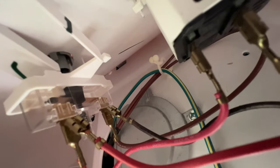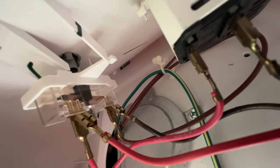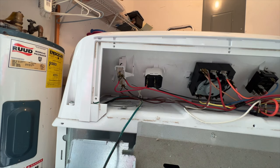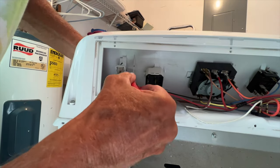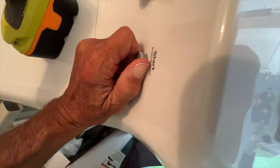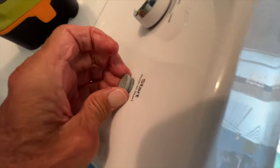To remove the start button, we've got to reach in there and squeeze those three little catches that go around the collar to get it out. I've got to pop that back in order to pull this out. I've got a pair of needle nose pliers, so I'm going to try to pop it out. This is starting to come out — see how I've got it a little bit popped out?